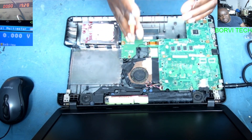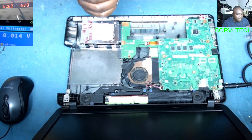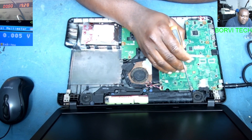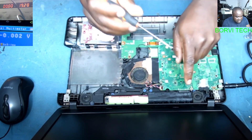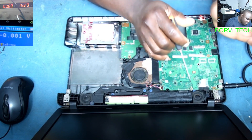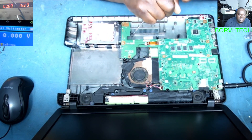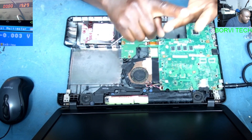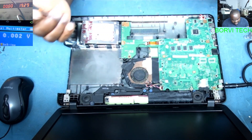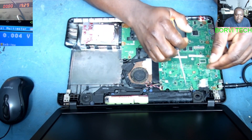ASUS is very tricky in this case. Remember if you check my previous video — the link is in the description below — on this motherboard there is a screw here, in between, close to the battery connector. If that screw is not contacted properly or not fitted properly, this laptop is not going to detect the battery and it won't charge. I've taken out the MOSFET — the first MOSFET of this laptop. You might think it's the MOSFET causing the issue, but no — it's this screw near the battery connector.